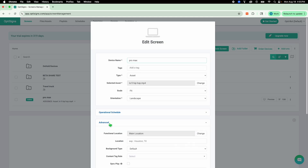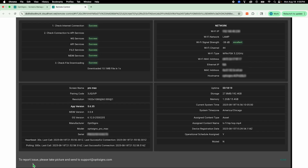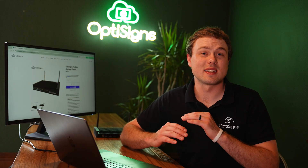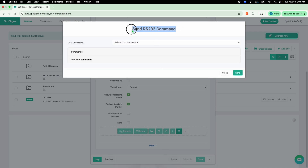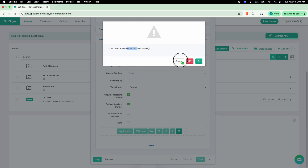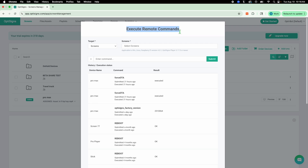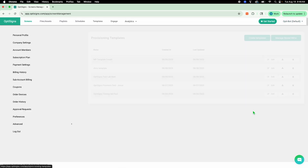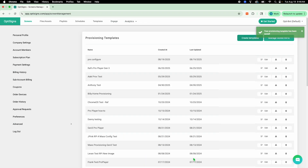If your Pro Max player is online, you can remotely access all this information from the OptiSigns portal. You have the ability to utilize every feature of OptiSigns with the Pro Max player, including sending commands to your player and the screen it is connected to. With RS-232 or HDMI CEC control, you can turn the screen on and off, deploy software updates, and much more. You can even mass provision your Pro Max players before install — pre-configuring devices to automatically connect to Wi-Fi, pair to your account, receive content, and more. All you have to do is plug in to power. Mass provisioning saves loads of install time for bulk deployments.